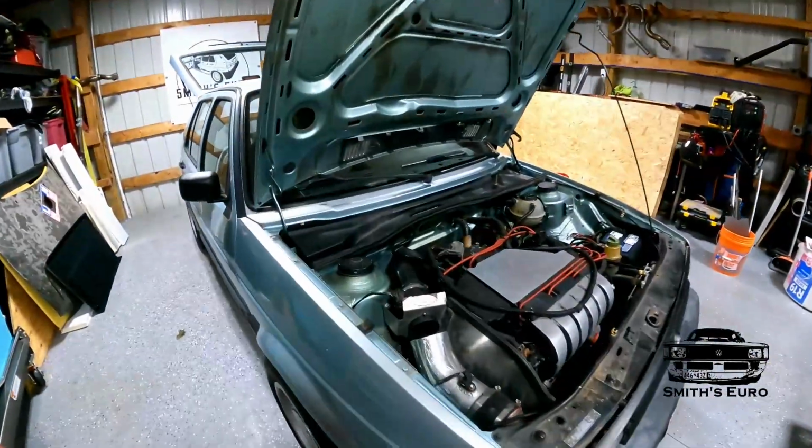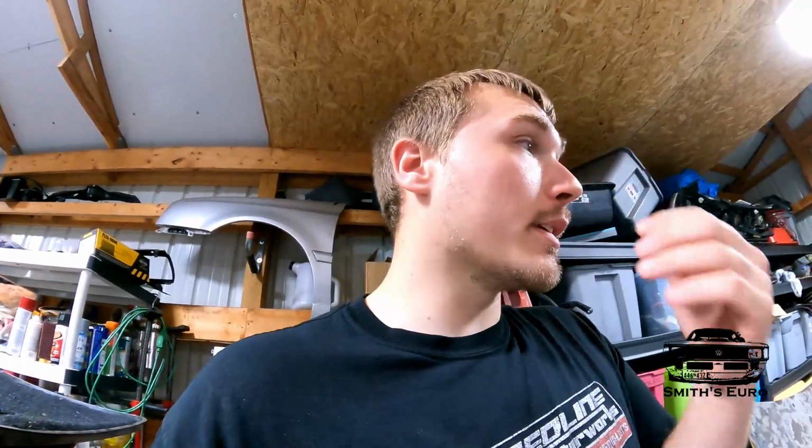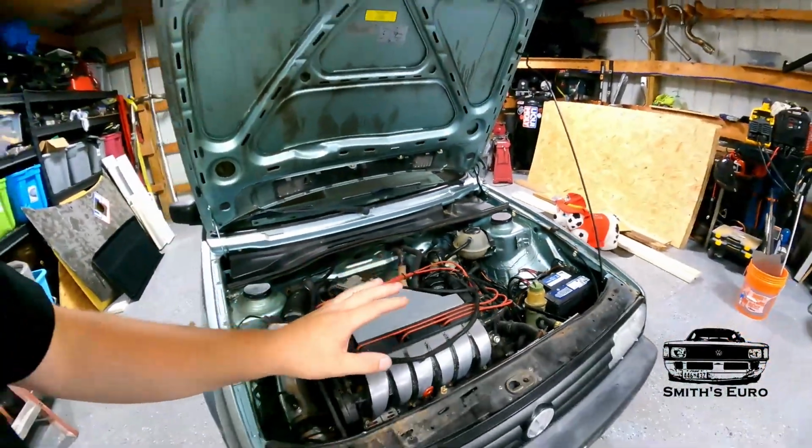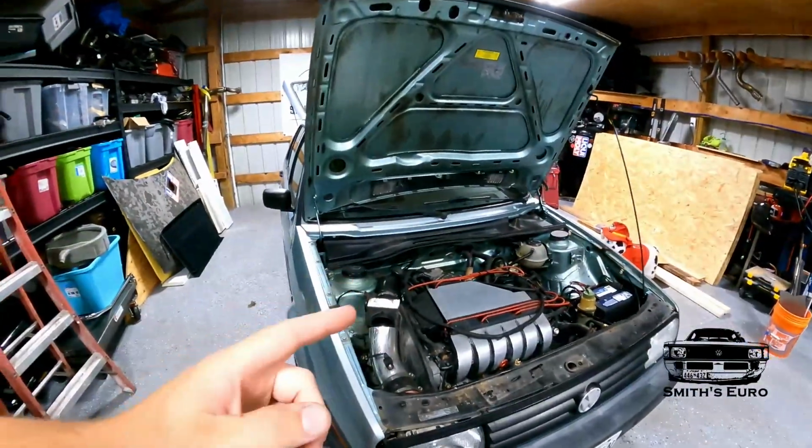Be sure to keep an eye out for the next video where we're going to take this to the Static Days event. It's only going to be test and tune. It's not like actual racing, but test and tune is still a chance to get out and see how the car is doing. Did a firewall brace to help with the clutch pedal flex, and I'm hoping that it'll be okay. If you watched the video at Junebug, every time I went into 3rd gear, it started to crunch. So hopefully bleeding the clutch and putting that brace in is going to solve that. If not, I'm going to have to live with it for a little bit.